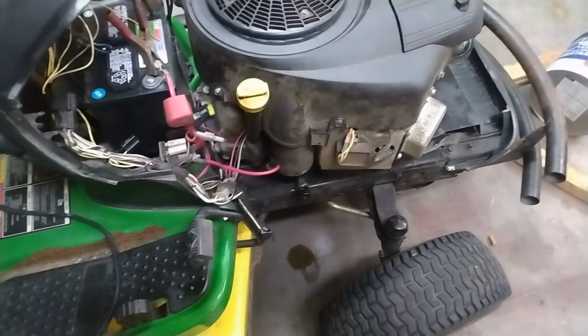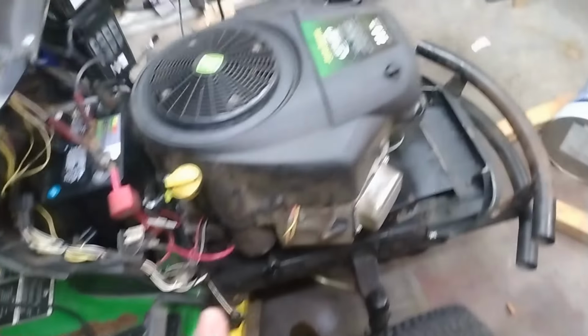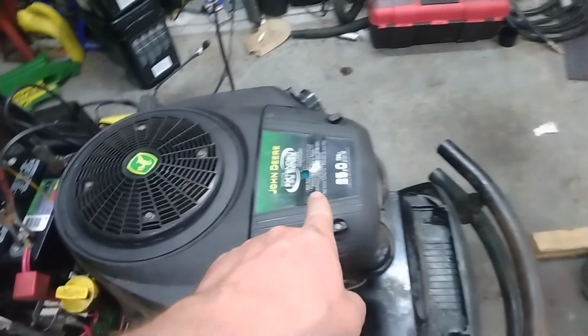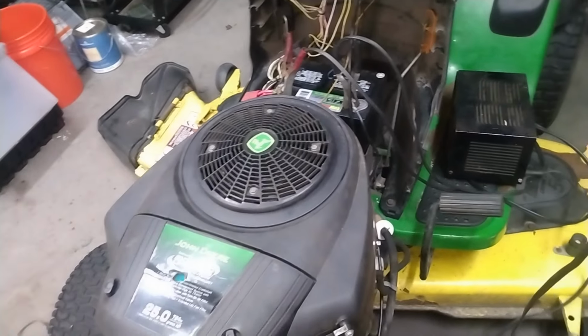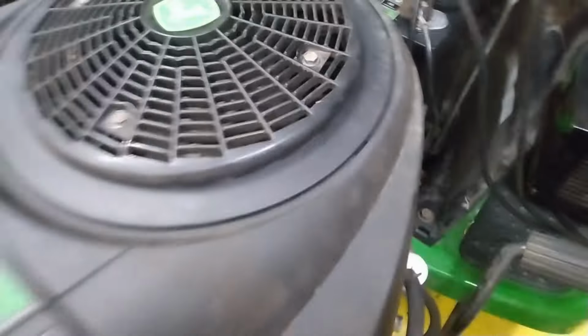let's start the mower. I changed the oil. See the spot of oil there? Because I missed. Put new spark plugs on, a new air filter in here where, you know, a squirrel chewed up the box, or a rat, mice, or whatever. New fuel filter, oops, and new oil filter. This thing is set to go. I got the box on jumper because there's another peculiar issue I read about.